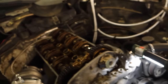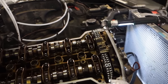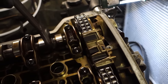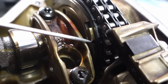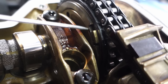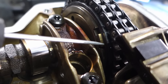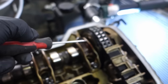The second thing where you can easily fail is camshaft position in the VANOS. First, you need to understand: this part is the VANOS unit, and this part is your camshaft. We want the VANOS to be advanced all the way to one side.